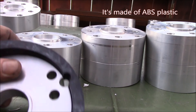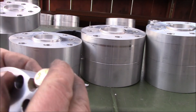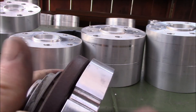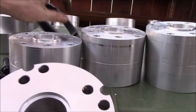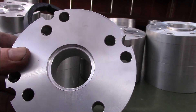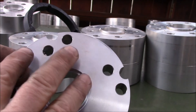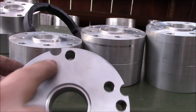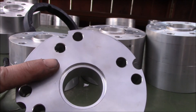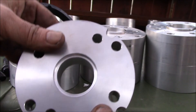The plastic ring isn't structural — the main body of the spacer provides your strength. The bolt goes through and clamps the two flanges together. With these we have one spacer that has all three of the 11 millimeter bolt patterns. That's the other thing we had trouble with previously: we had two different spacers and people would order one and find out they needed the other, so they'd have to send it back.